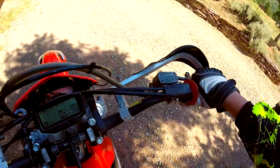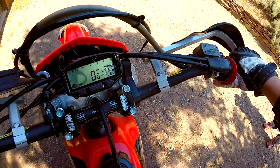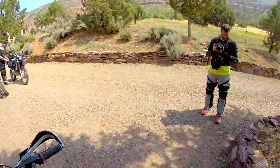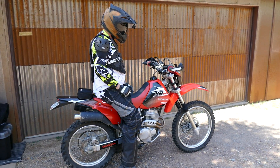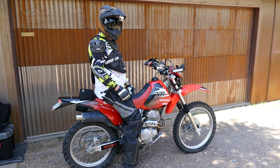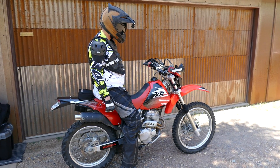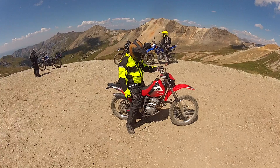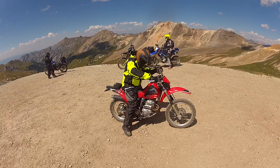Now that it's running and warming up, I'm gonna turn the choke down a little bit, grab the idle screw, and turn it back about a third of a turn. Now it's running at about 1300. As the bike gets warmer the idle will crawl up a little bit, so once it gets up to around 160 degrees it'll be idling at 1600 — I'll reach down and knock that idle screw back down to 1300 or 1400. That right there is the cold start. Wasn't that hard, was it?